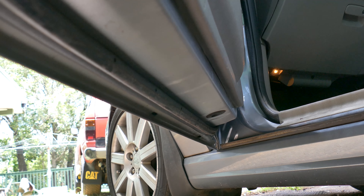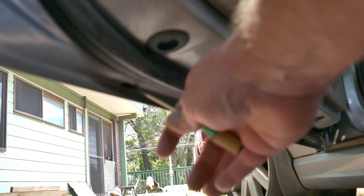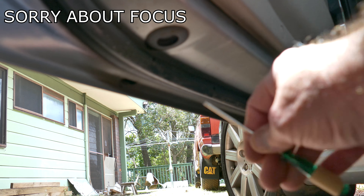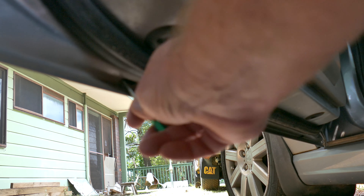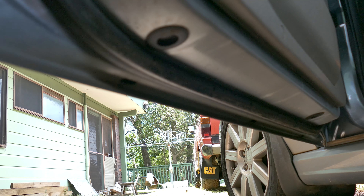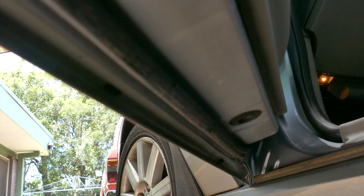If you open your car door and look down below, you'll find there are drain holes underneath — usually about three of them. Get either a tiny screwdriver, a stiff piece of plastic, or wire, and carefully prod up there to make sure they're clear of any muck or moisture.